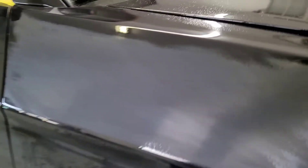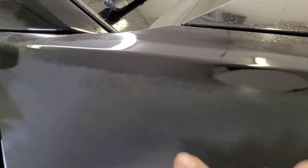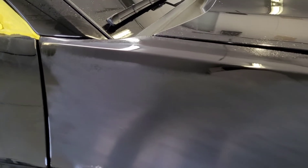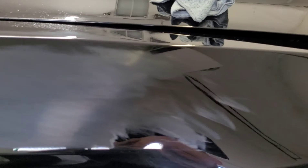You want to stay away from your edges as the edges have a lot thinner paint on them. I don't want any of this shiny left over — it's going to look really smooth when I'm done. So this is the look we're trying to achieve. See how there's very little if not any indent at all — those are still the orange peel. If it's nice and smooth like this, then I go to 3000 grit, then a 5000 grit. I'll show you those steps as well, and then you go to polishing.